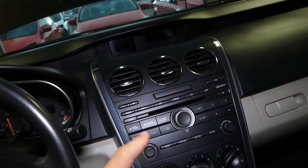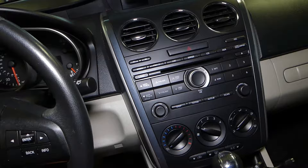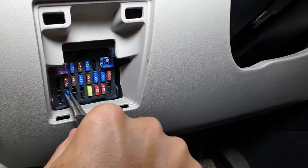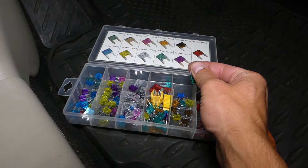Not always will it be labeled 'room' — check for interior lights, room, radio, or accessories, something like that. So I'll go ahead and remove that fuse now. Pull it out — this is it, a blown fuse. If you need to buy new fuses, you can check out the link in the description of the video below where you can get replacement fuses for an amazing price.